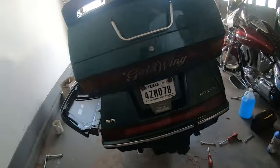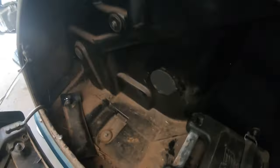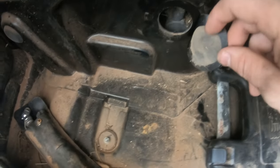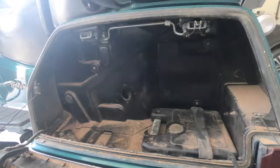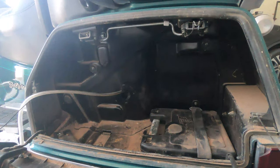After the front left is done, I move on to the rear brake. Some earlier models didn't have the cutout in the saddlebag to access the bleeder — people typically use a hole saw to make that hole and cover it with tape, which is common on Goldwing forums. Thankfully this 1996 model had the cutout already. I just get my bleeder onto it through the hole and repeat the bleeding process on the rear caliper, though it's pretty tight in there — an open-end wrench works fine.